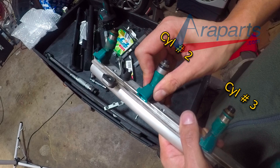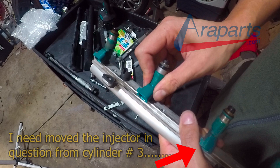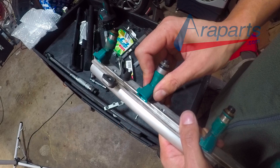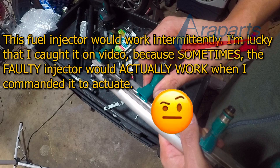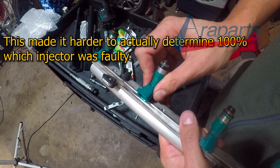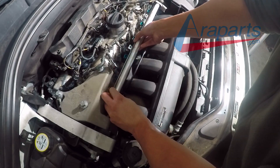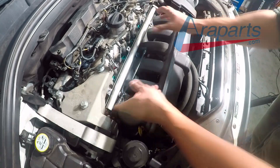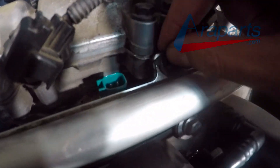I have cylinder number 2 and 3 fuel injectors here. The misfire was originally on cylinder number 3, so I'm swapping them — putting 3 on 2 and 2 on 3. Now, the actuation test worked earlier because the injector wasn't working at all, making it easy to identify the problem — but that's not always the case. This injector started working again not long after, only causing misfires when cold and smoothing out as the car warmed up. Not everyone will catch that with the actuation test. The only way to be sure is to swap the injector and double check where the misfire moves — the computer will record it.